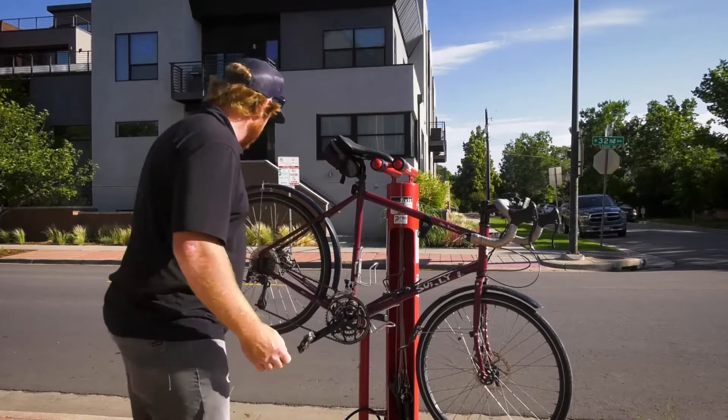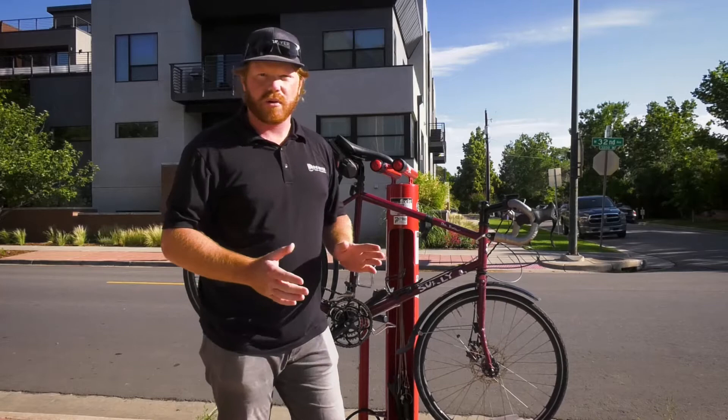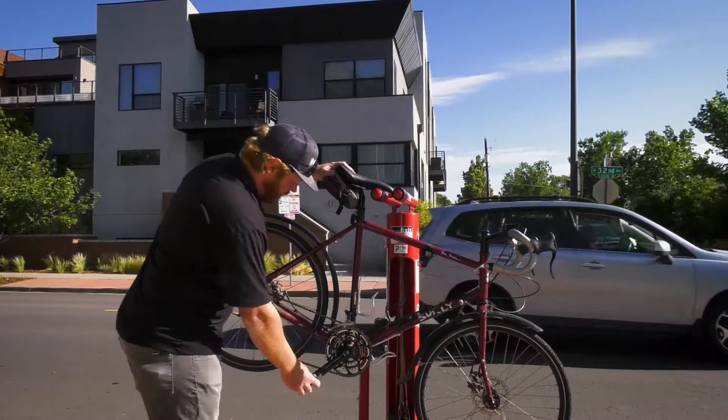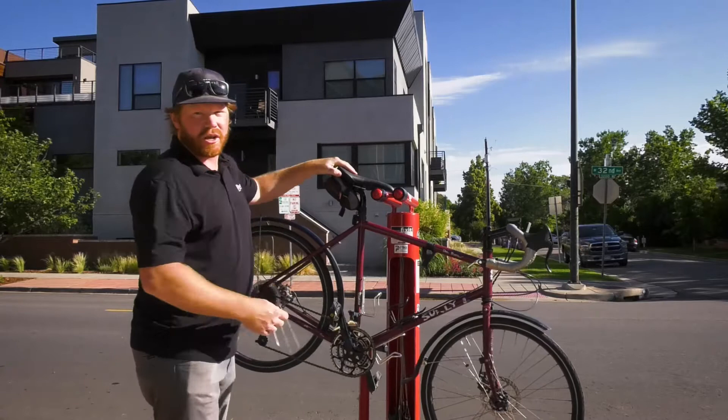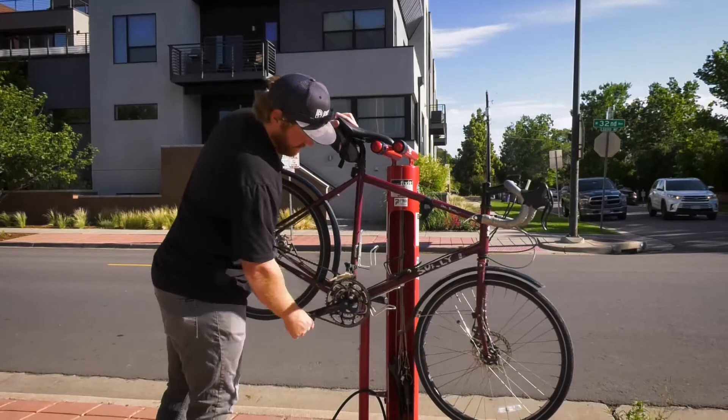Next, check your brakes by spinning your tire, grabbing your brake lever, grabbing both brakes, and then rolling around with your body weight on your bike using your brakes to make sure they work properly before you go out. Then check your chain — put the bike on a stand, pedal it around, and make sure it's smooth rolling with no weird noises and not too loose. Your chain should have just a little bit of play and roll smoothly with your cranks.